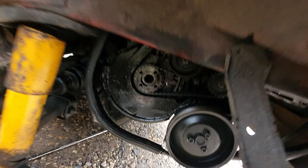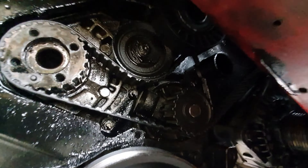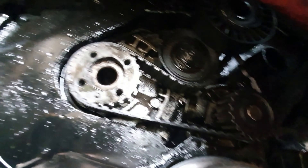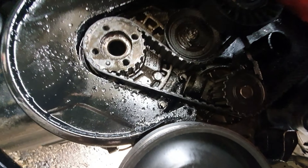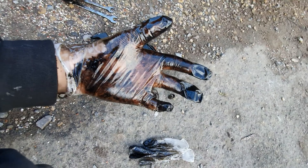I'm going to give this a good clean before I try touching any of it. I wish I'd paid someone to do this. Well, two pairs of gloves later and a cut finger — managed to get the pulley off to expose the belt, and look at the oil, it's absolutely caked on. All I need to do now is take that belt off, get underneath that pulley, and that's where the problem lies. Give it a good clean and get this belt off.